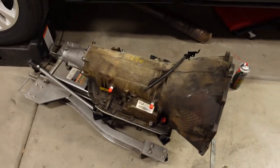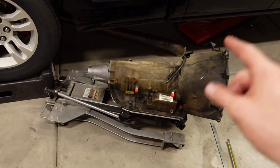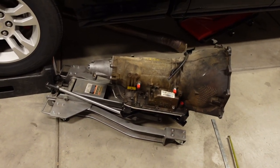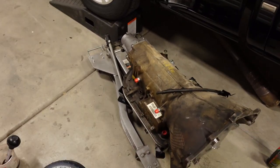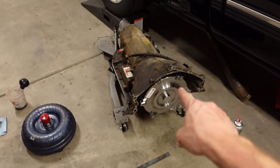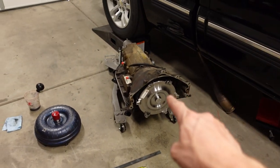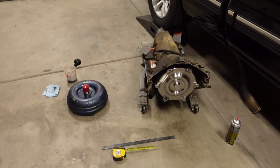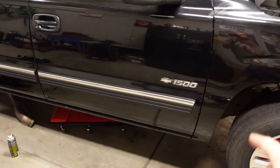It shredded itself and it took out a whole bunch of stuff. So about three weeks ago after I pulled this out, I decided let's do a complete rebuild. On the inside of this 4L80, even though it does look a little dirty on the outside, we have all new clutches, steels, seals, thrust bearings, thrust washers, a whole bunch of other stuff, and then some hydraulic modifications to increase the holding power. And finally, the one part I wanted to install way back in the beginning of September: a Circle D 3400 RPM stall speed converter. Now we are ready to get this back attached to the 8.1 in the truck.